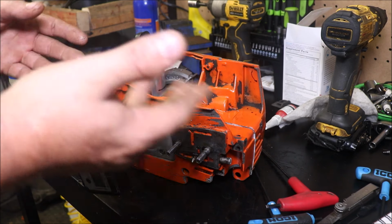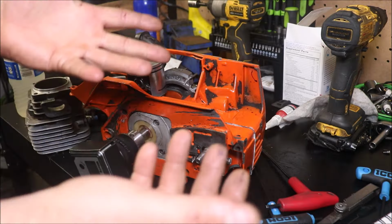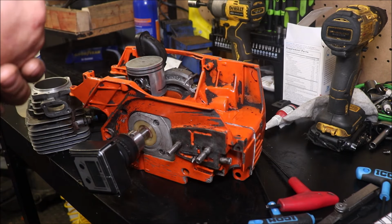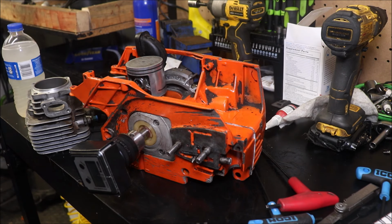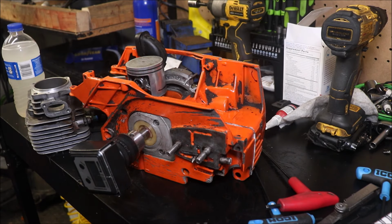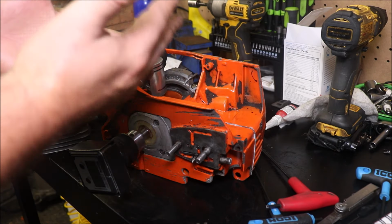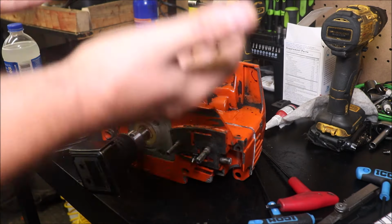to give us room to go in and do our cleanup and our polish, and I'll probably stick to the original shape that's there, just make it a little bigger, make it flow a little better, and give it a good polish where carbon doesn't stick and build up over time and risk causing the cylinder to fail. That can happen, and yes, polishing does prevent that. I've had saws back in here that have been out in the field for over a year to 2 years, and the exhaust port looks almost identical to what it did when it left here. And a lot of that goes to quality of oil and fuel that you're running.